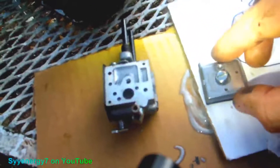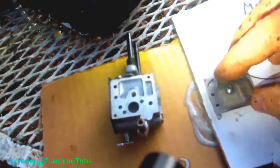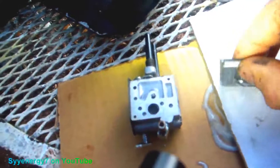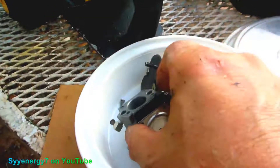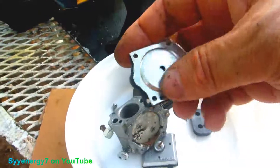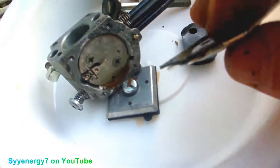It goes like that, probably only goes one way. This little tab goes right there — you could put it another way I guess. I'm going to put this in here. Take a look at this side. That freaking shitty gas — I did this a couple years ago and shitty gas screwed it up already. That's ethanol. I'm putting all the parts in here. Took this off — the whole face is just a diaphragm. I can see the dirt down in there, all down in here.